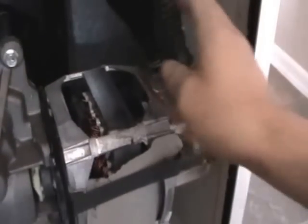First thing you want to do is probably check your hoses to make sure that's not where your leak is coming from. The hoses run all through here — just make sure that's not where your leaks are coming from, and if they are then change them out. But this is where my problem was. You can see where it's all rusted over here and it just started leaking real heavy, flooding our tile. It's a simple change — all you're going to need is some needle nose pliers and a screwdriver and you're good.